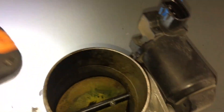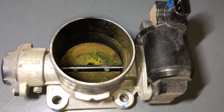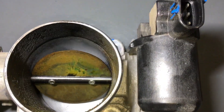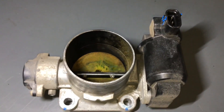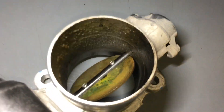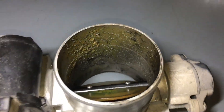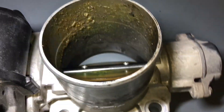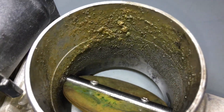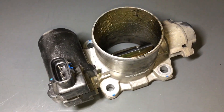To clean this stuff, it needs to be physically removed and physically cleaned. Spraying some gear through there — if you had a minimal build-up, like on some petrol engines, it might work out. But look at that build-up — that is the sort of build-up that will stop this flap from moving. It'll foul and cause problems. So yeah, carbon cleans? No. The green machine? No thanks.